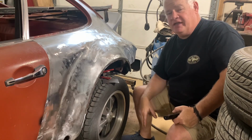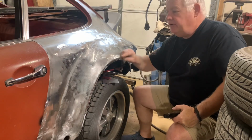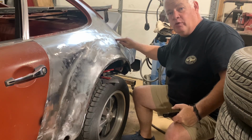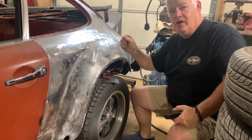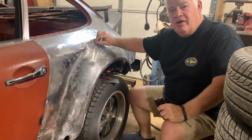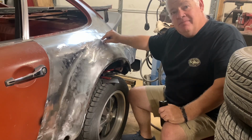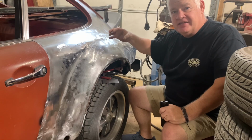when I'm gluing metal together. I'm gonna take that and use it just like a body filler, and I'm gonna go over where I TIG welded the quarter panel on. I planished it and TIG welded it, but when I was grinding it, there's a few spots that I see that I missed. I went back over everything with the sandblaster and blasted my bead down to where I know I got all the carbon and stuff out of it.